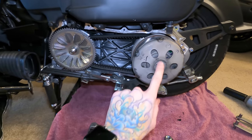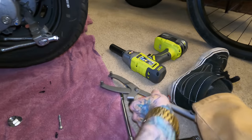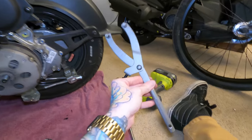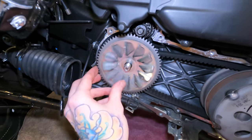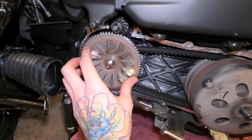Both of these nuts are taken off — a 19 mil and a 22 mil. I used my fancy new impact gun to take that off. And then I have a little clutch holder here that was about 11 or 12 bucks on Amazon — I'll link that below. Essentially those little feet hold in here so the clutch doesn't spin as you buzz it off. This one was able to come off without any sort of holder; I didn't want to put anything in the fins and bend it, but it came off no problem.